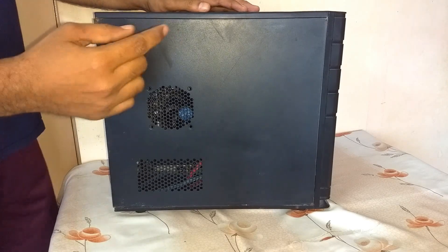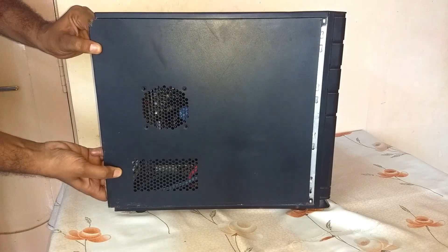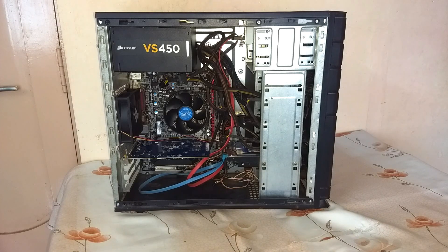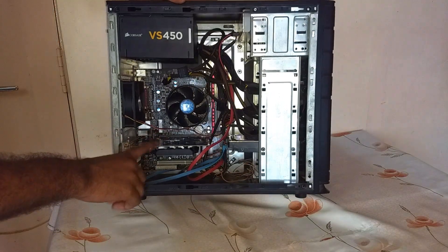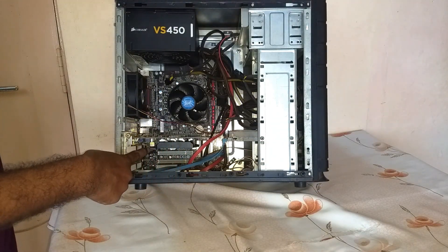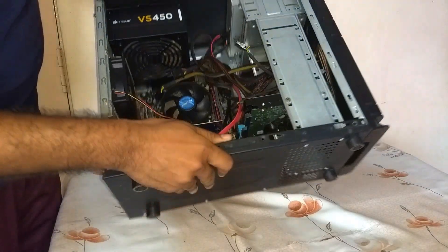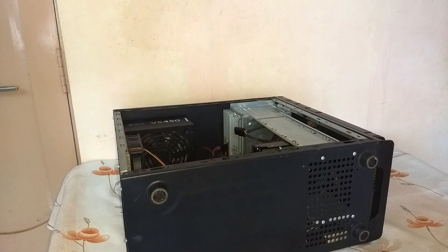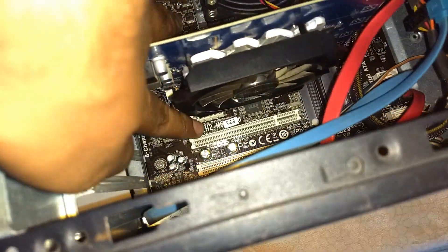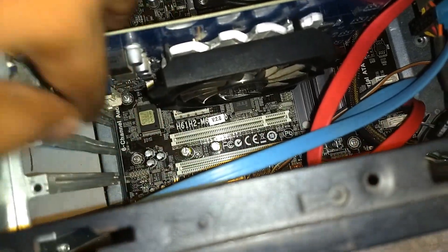So here is my cabinet. You will have two screws right here — you may already know how to remove this. Just take it out like that. Here you can see the graphic card, and below this frame we have the PCIe X1 slot. Actually it closes off the whole area. Here is the graphic card and this is the frame. Now you can see — under the graphic card you can see this small slot, that is the PCIe X1 slot.